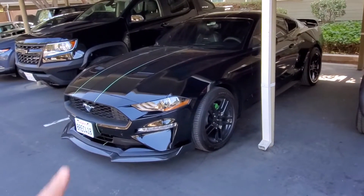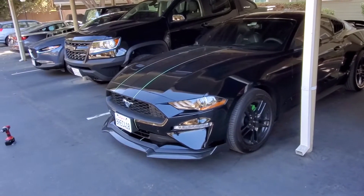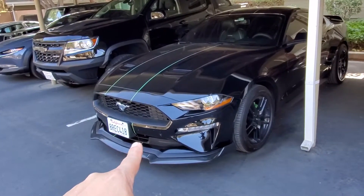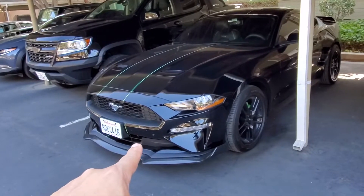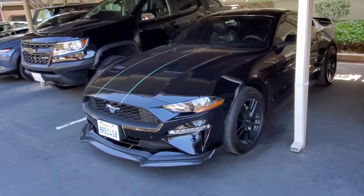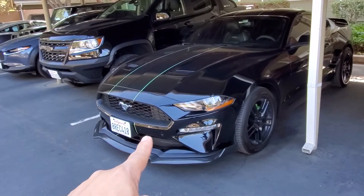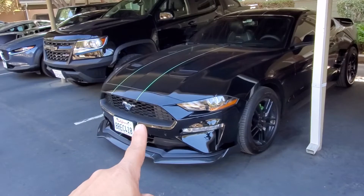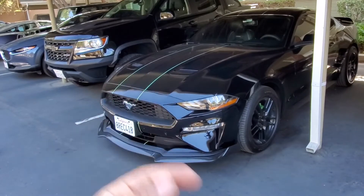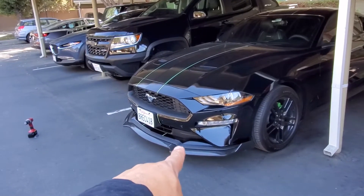So that's what we're gonna do here with the Mustang — install some struts up front. I'll show you how I'm going about this. We're gonna go underneath the bottom grill section, come up from underneath, and then go up to the top in order to secure the nut. On the very top lip underneath, that's where I'm gonna drill the hole for the strut to insert, and then reaching from behind I'll put the nut on it and screw down the strut itself.